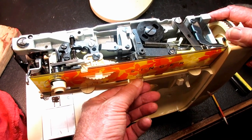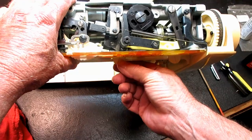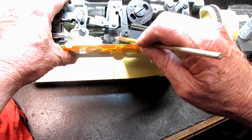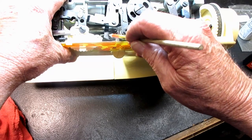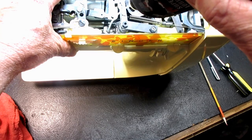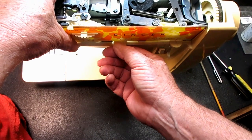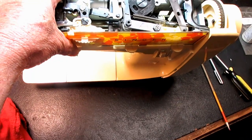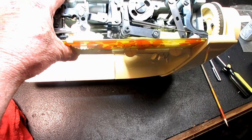The left-center-right selector — behind that plastic part you grasp is a steel plate that moves against the steel lever, screwed together with a hinge screw. So you've got metal on metal there and I drop a drop of oil there. Some people might go a year before they move their left-center-right, but I want some oil in there so when that day comes you can move it and not wonder why it won't move. I'll mop up the excess because I got about two drops there.